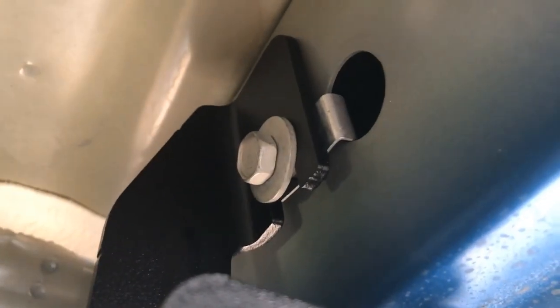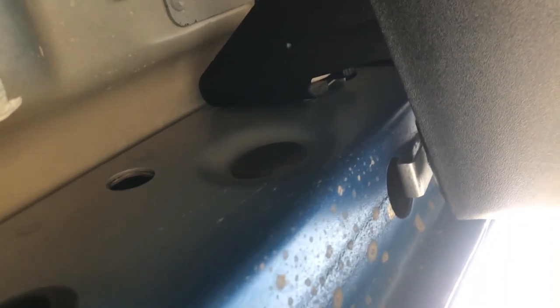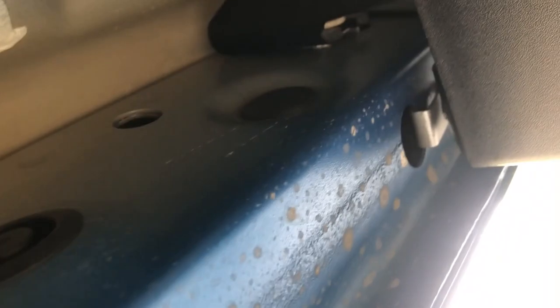All right, folks, you should be able to see the bolts here. And if you look, there's like a hook on each one of them. And that is how we are hanging these under the truck to take the weight off so you don't have to hold them. Now, I will say, GM made these casings close, so I really did have to take 3 of them out. So I would start with one at the front or the rear, get it hung up on there, and then go to the other end and put one in. After that, putting the middle ones in are super, super easy.